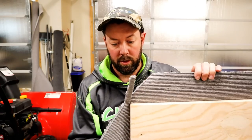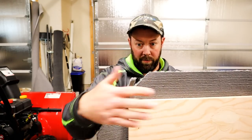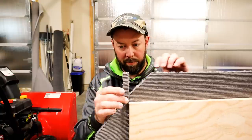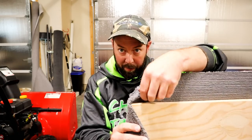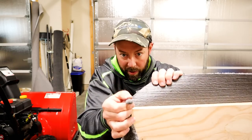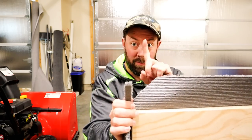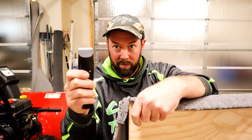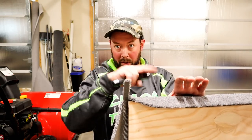We've made the appropriate cuts. The front and the back are going to just have these flaps flipped over — that's where this tab comes in. See how thick that is? When this gets flipped up and that tab gets laid down, that's going to go over it and meet up here. I want to get this so the carpeting isn't too thick. So what I'm going to use — one little trick — just use this and you can skim down some of that carpeting that's on here so it lays a little bit flatter.